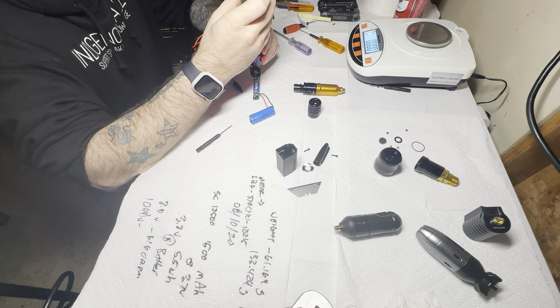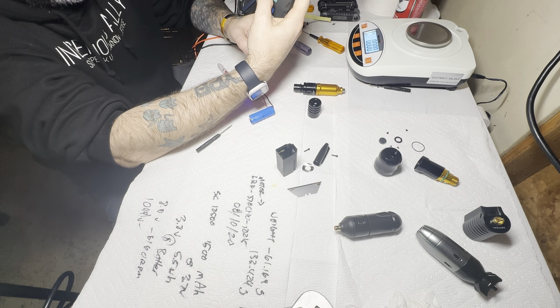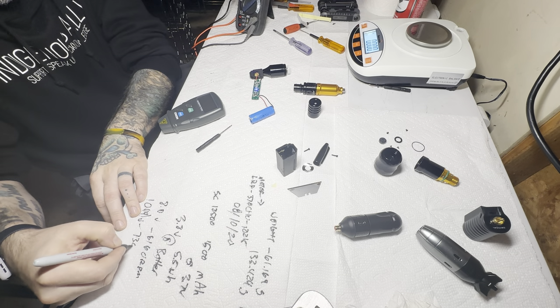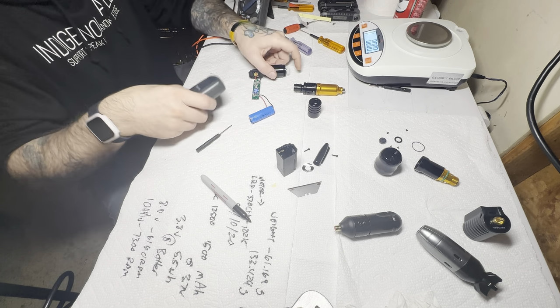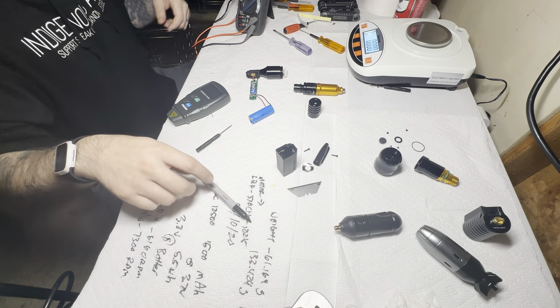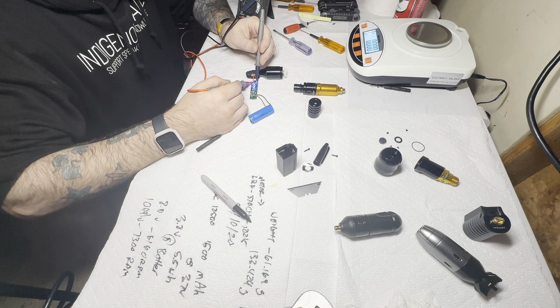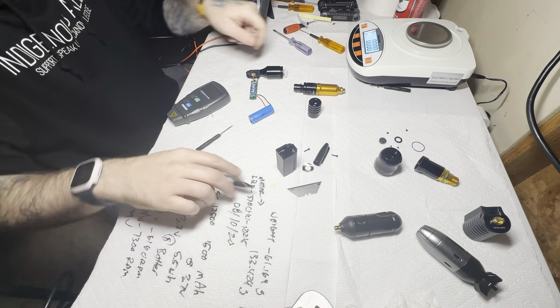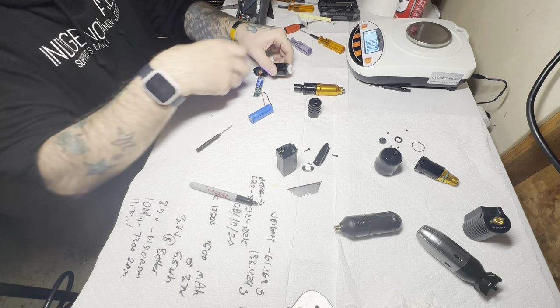How many RPMs on this sucker? You can notice we'll jump on this — about 7,300 RPM at that now. And if we can drop this back down — that sounds awful, probably just because that pivot plate is actually a little bit loose on there for the flywheel. Now we're at 11.5 volts — 11.79 volts. It's a little high, probably supposed to be 11.5. Our speed on this sucker is now about 8,500 RPM. Wow, that's pretty good.